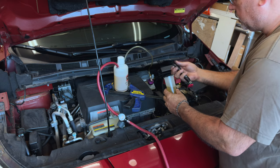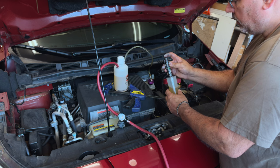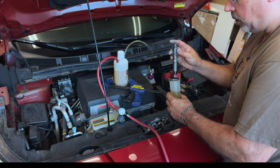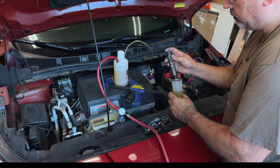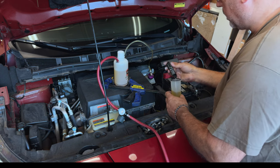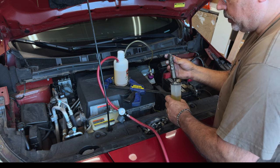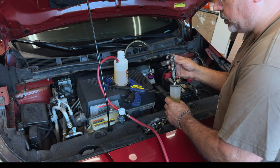We can run a little test on the brake fluid I pulled out of the cylinder. I basically press it and check — if I check this a few times, we're probably less than one percent, close to two. Keep in mind I pumped out the master cylinder and refilled it a little while ago. But when I did check it originally, I was just seeing two percent — between one and two percent. With these inexpensive testers you really do need to try them a couple of times. We can also try the copper test strip to see what we're getting — I'm expecting not to see much because the fluid we took out is pretty fresh, literally like a month ago. At one to two percent moisture, that's considered okay, and that's a good sign that now's the time to change it. I wouldn't wait till it gets to three or four percent, because then you may be introducing corrosion into the cylinder.